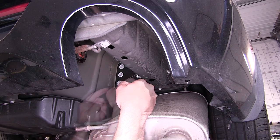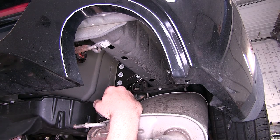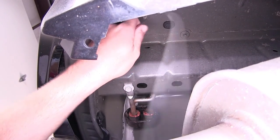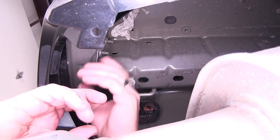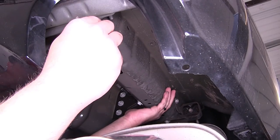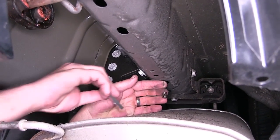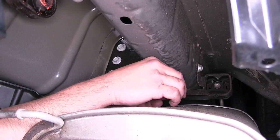To get the hardware into the frame we'll use a 7/16th pull wire that's provided with the install kit. Then once the hitch is in place and our hardware is pulled into position we'll secure it with the 7/16th flange nut. Go ahead and start by taking our pull wire, feed it through the attachment point and out the access hole. Now once we have the pull wire fed out the access hole, we'll take our block and slide it on and thread the carriage bolt into the end of the pull wire.